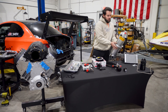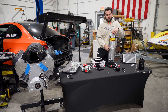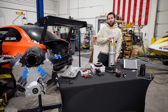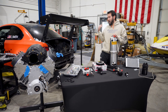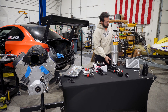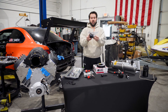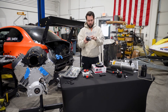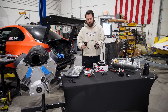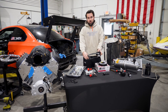Once it's back into the tank, you'd have your normal catch can setup like what we ran before — this is just going to vent from the top. So we'll run a normal catch can system off the dry sump tank. For us, this is going to be located towards the back of the car above the fuel tank on the passenger side. With this setup, we need to run an ATI front damper and a different hub assembly. This hub assembly has the gear which drives the belt, which spins this cog, and this is going to spin the pump.